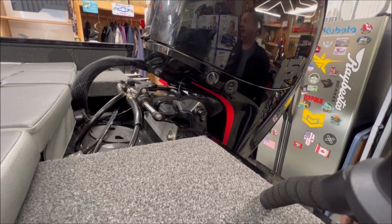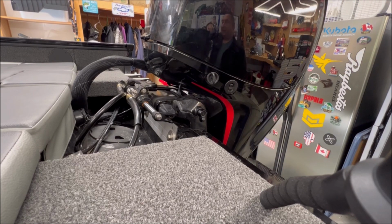Just like that. Now, depending on your Mercury model and or year, Mercury will say in some instances at idle, you can use that garden hose connection to run your engine. Other years and other models will say, don't even bother doing that. Just use the muffs like you normally would to run your engine, if you want to use something in the driveway. So look at your manual.